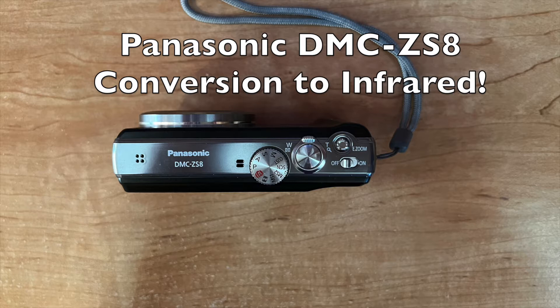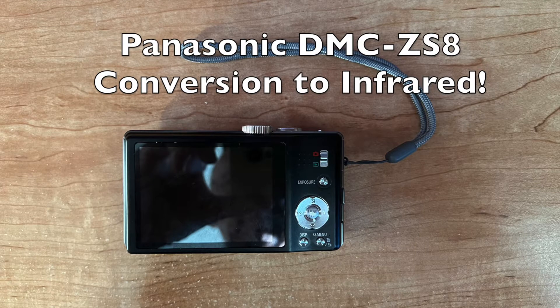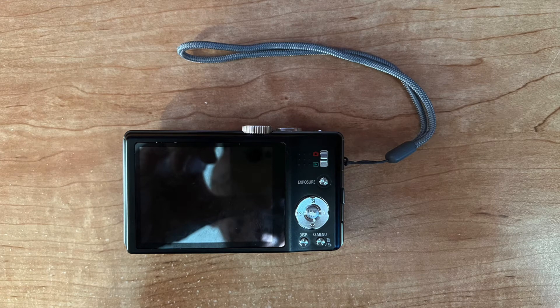The problems arise when you remove the infrared blocking filter. Some point-and-shoot cameras can't focus properly because the little infrared blocking filter that was in front of the sensor — its thickness is not accounted for and the lens can't move forward or back far enough to get a correct focus. I found a good resource on YouTube by a fellow named Graham Houghton who converted a similar Panasonic point-and-shoot camera. I'll leave links in the description below.